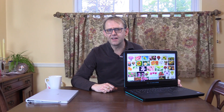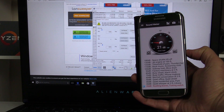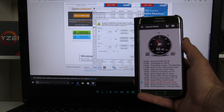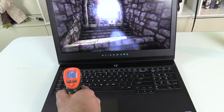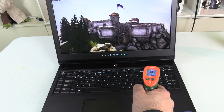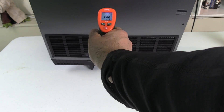I do like the 1080p webcam — the webcam has always been excellent on Alienware. The fan noise at idle is nice and quiet: the CPU fan spins at 1600 RPM and the GPU fan at 1800 RPM, giving about 21 decibels. At max load the fans spin at 7000 RPM but are still fairly quiet at 46 decibels. Chassis temperatures are 27°C on the trackpad, 35°C on the WASD keys, 30°C on the number pad, and about 49°C to 30°C underneath.